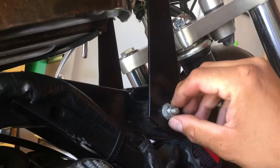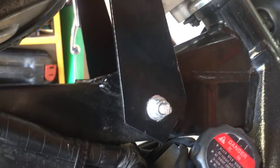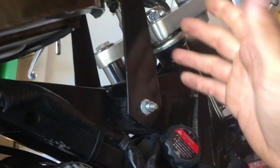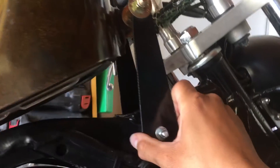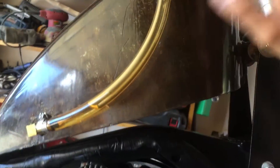We fabbed up these pieces of steel right here — simple. If you like skulls or death metal or whatever, fab up something else, but we just did something real simple. It's pretty self-explanatory if you've got any mechanical experience. We put a big flat washer on this side to stabilize the rubber, then the steel piece, a lock washer, and a nylon lock nut on the other side.